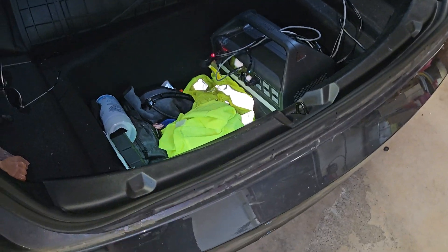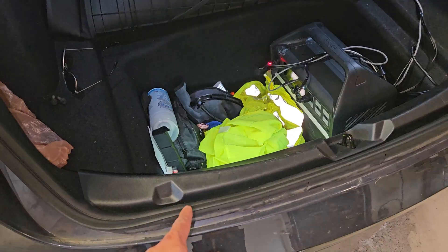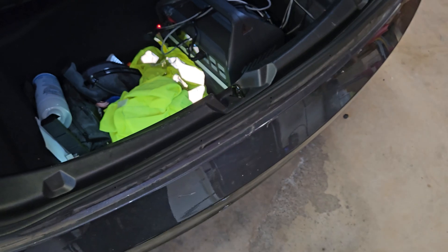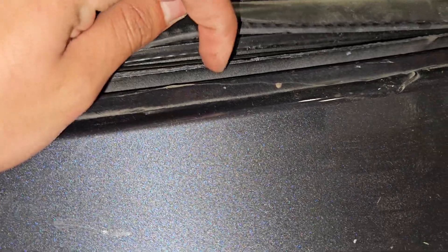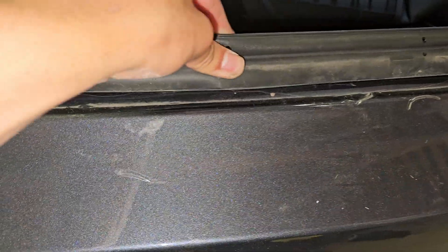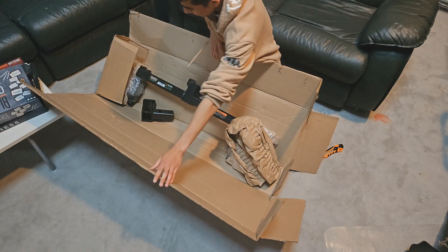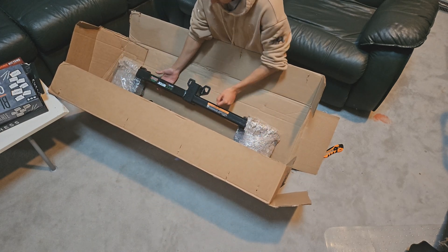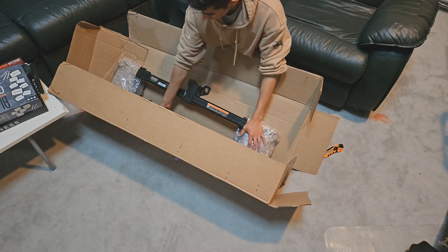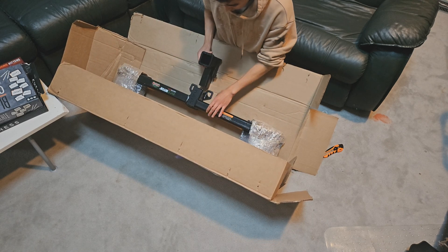Tail lights are back in — not going to lie, this part sucks. Tuck the carpet behind the weatherstripping on both sides. Put the black plastic on and then start putting the weather sealing on the frame. This back part sucks because of all the sticky stuff — you've got to get this exterior groove to go in between here and this middle groove to sit down. It's finicky and takes a while, but have patience, because this is your weather sealing and you don't want water getting in your trunk. Don't forget to put the bolts you removed from the bottom back in — there are two under the little floppy flaps next to the access panel we removed, two bolts on the side, and then two bolts up front. Make sure all those are in so your skid plate is held up to the car.